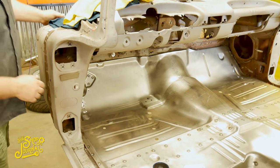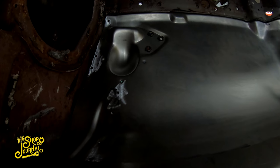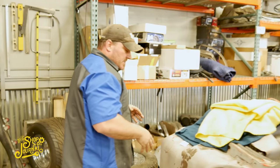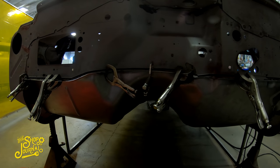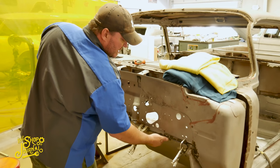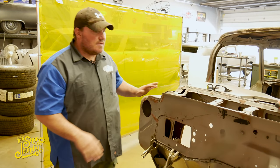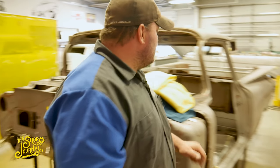Right now I'm working on this front piece — the final toe board section where it meets the firewall. You can tell by these marks where I'm going to rosette weld it into all the original bracing underneath. Once it's pushed down you fill those up with welding and you're good to go. I have it all clamped up into position right now, with holes underneath so I can rosette weld it to the original factory flange all the way along — it'll all look bone stock. This is a very stock build; the owner didn't want any special mods done to the body.